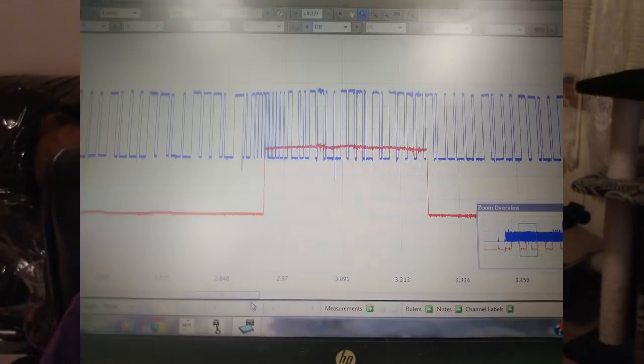The reason I did this is because you guys liked the last one. Some of you commented that it made you think. I like the ideas you have here — get a known-good signal, because you have to know what good looks like to pick out a bad one. From experience with these trucks, that is absolutely a bad signal — 100% there's a problem in that crank signal. Some of you said check the wiring harness, load test power and ground — great, fair enough.